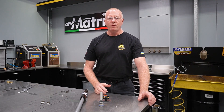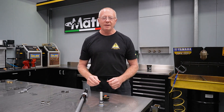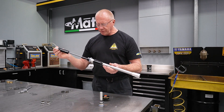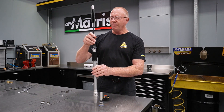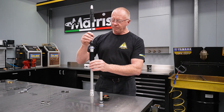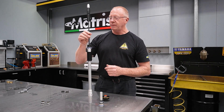We've taken the cartridge out of the fork tubes — we don't need to see the fork tubes, they're pretty standard amongst motorcycles. Here's our 4-Chamber fork; 4CS stands for 4-Chamber. So it was something unique in its time. We have a lot of seals in this cartridge, and basically it's the seals that separate the chambers and give us the 4-Chamber setup.